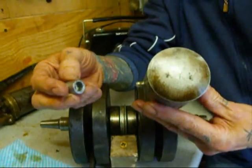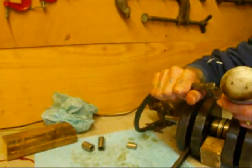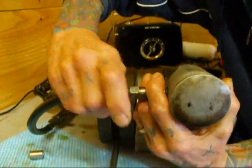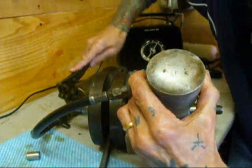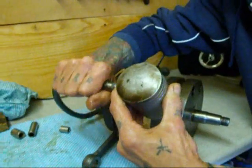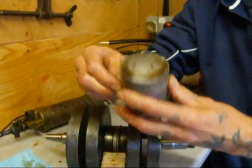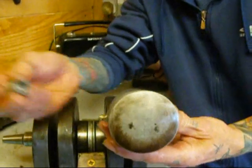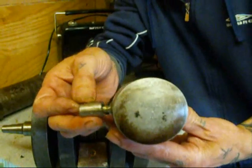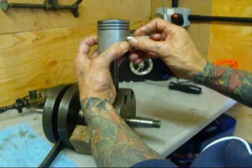But if this is the first time you're going to take it off, and the rollers are dry and loose, you need to put the grease gun on. Bang it on there. How much? About four, five, six pumps, as much as you want really. You can't put too much grease, I suppose. No, not too much. So now we've filled this small end with grease, we can get this tool, the recess side on the grease nipple, push it in, and take it down.